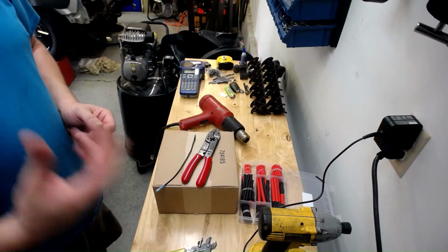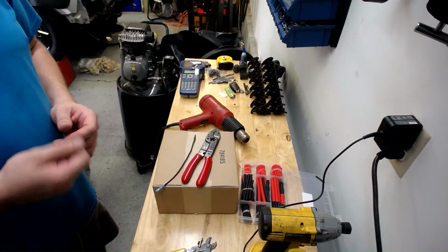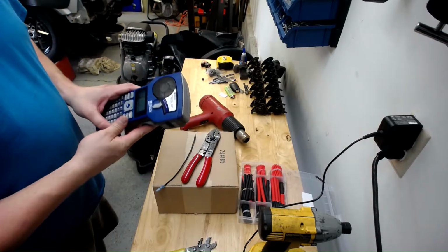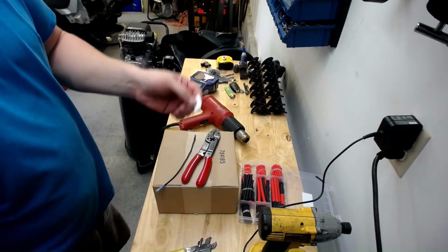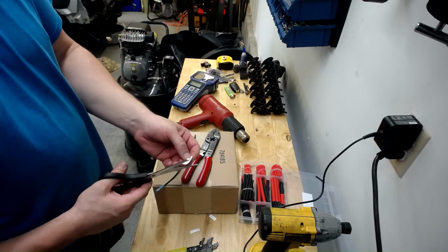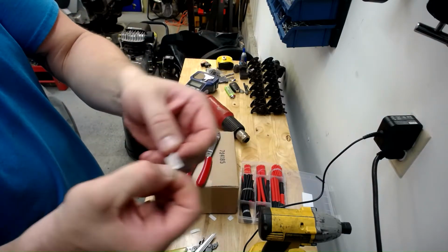The other part of that is you go to the track or you're stuck on the side of the road and you have a bunch of wire that's the same color, or you kind of forgot what wire you put where. Thing that'll help with that, if you have access to one, label maker. What I like to do, make a label. In this case, I have one already made. It says fan supply. What I normally do is I'll trim it up a little bit, depending on the size of the wire you're using. I like to not trim the end where you can peel it back.